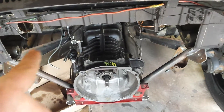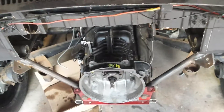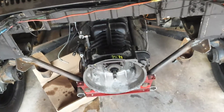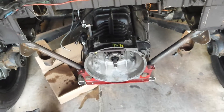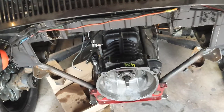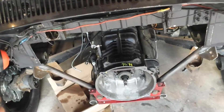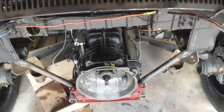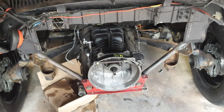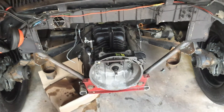You don't have to cut the package tray out necessarily if you're doing a Subaru swap — I've done it without it, but that was a non-turbo 2.2 liter. This one being turbo, I either have to relocate the turbo or make room in the car for it. That's something to consider if you're looking at doing one of these swaps, turbo or non-turbo.